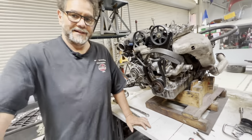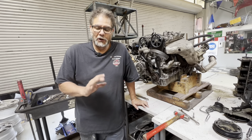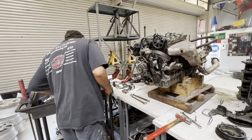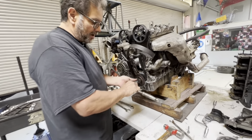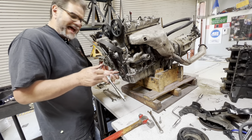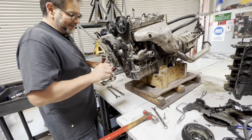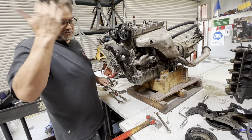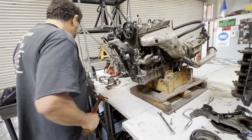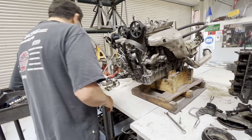Another method — my wife always asks 'how dangerous is this from one to ten?' This one's a level three. Sometimes I'll take a ratchet with the right size socket, put a long breaker bar on it, set it up in the car against the frame rail, and tap the key — when I tap the key it cracks that loose. It's a little sketchy but it works; we used to do that at the racetrack. But you saw I just broke it loose with the hammer and a wrench, so that's the easier method if it works.